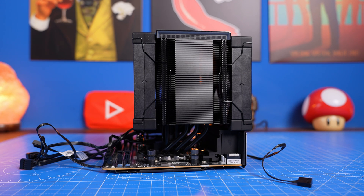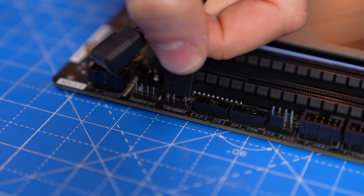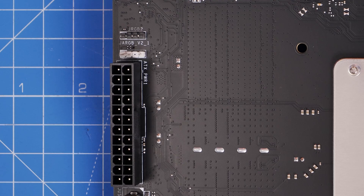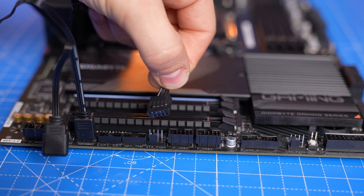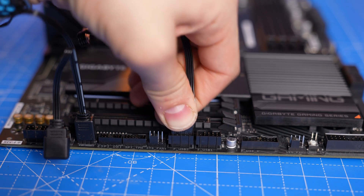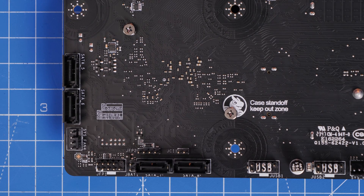If you have an additional fan, use that Y splitter. There's also an RGB connection from the tower itself that goes to the 5-volt RGB header — it only has three pins, so don't try and use the four-pin 12-volt header as that won't work. On this rear-connect motherboard it's at the back above the 24-pin power cable, but check your own motherboard manual to find where it's located. Then there's a USB connection that allows you to control the data shown on the display from Deepcool's software, which you'll need to download from their website — I'll leave a link in the description.